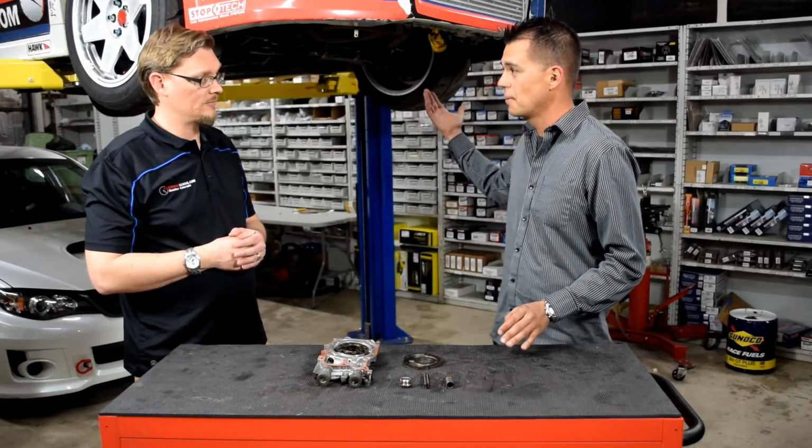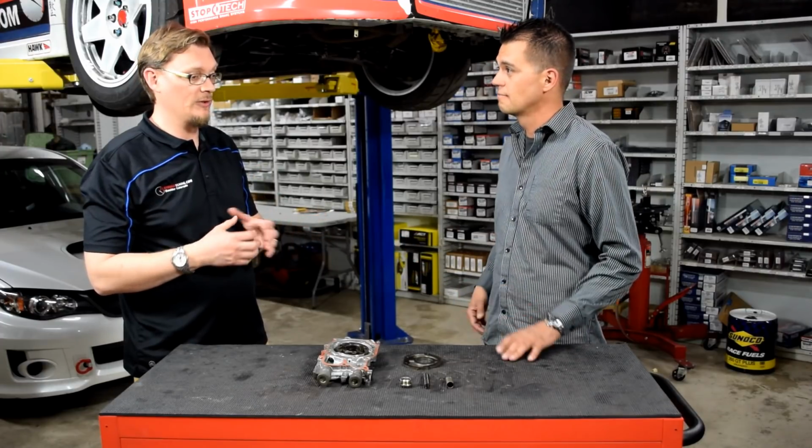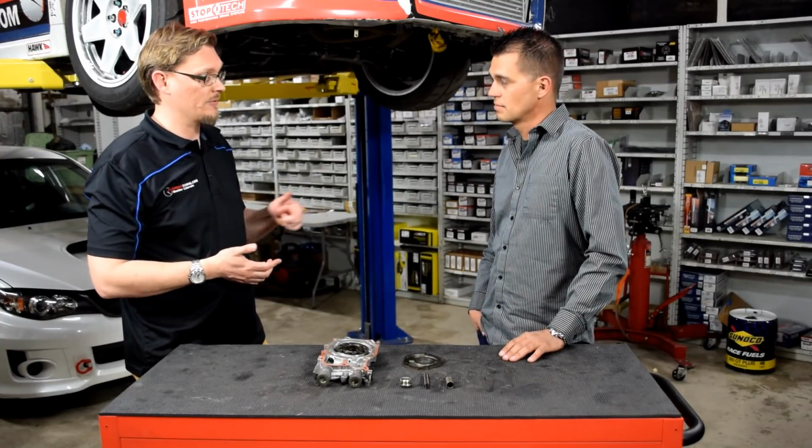As I opened up the tolerances on the engine, I basically created a bigger pipe. Right, you're putting on a larger fitting. Another way to say it is you're reducing the restriction on the oil as it flows through the engine.